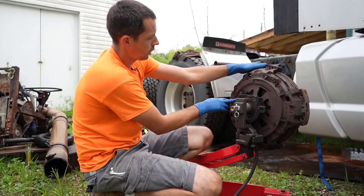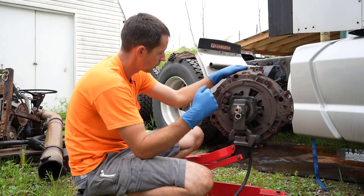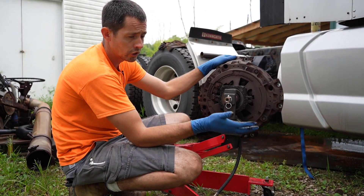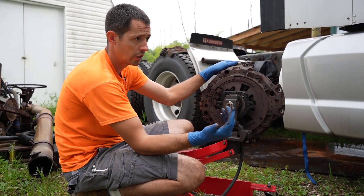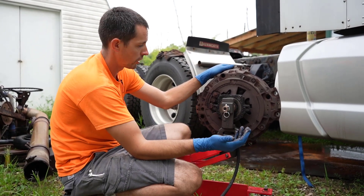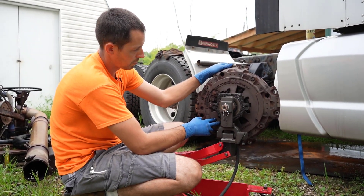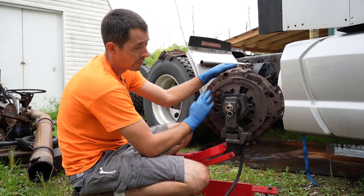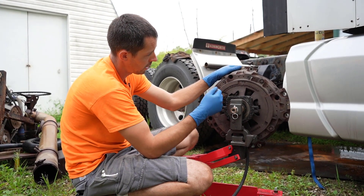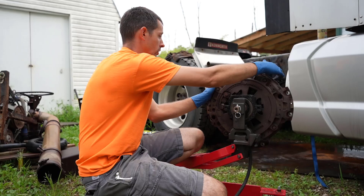This is a manual adjustment clutch. I don't recommend the self-adjusting clutches, because in most cases it seems like they adjust themselves twice and then they never work again — and then you've got a burned-up clutch. The manual adjusting ones are typically more expensive than the self-adjusting by like $50 or $100, but I always recommend getting the manual adjustment clutch. Once we finish this job, I'll show you guys how to adjust the clutch — all you need is a three-quarter inch socket or wrench and a half-inch extension for a feeler gauge, and another person in some cases to help you push the pedal.